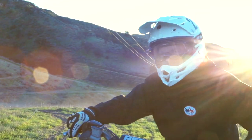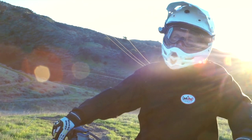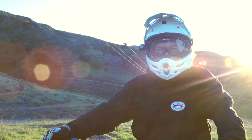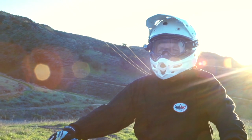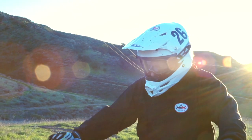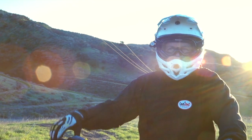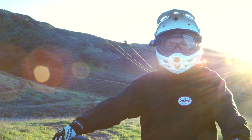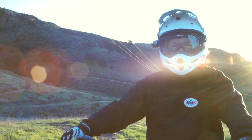Wow, nice tune-up. This thing is running great. I can't believe the air filter was really that bad, and all the little things that you don't service really add up. We fixed the throttle linkage, the hot start linkage. We inspected the header pipe for cracks and leaks and the gasket. And the biggest improvement was the fuel air screw.